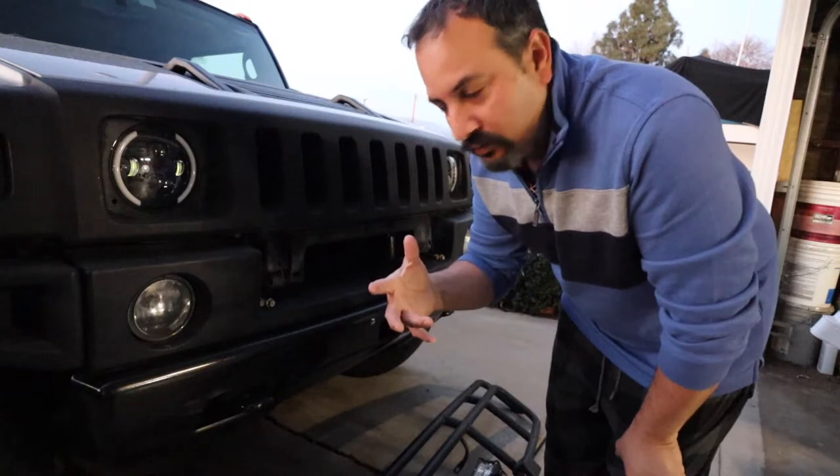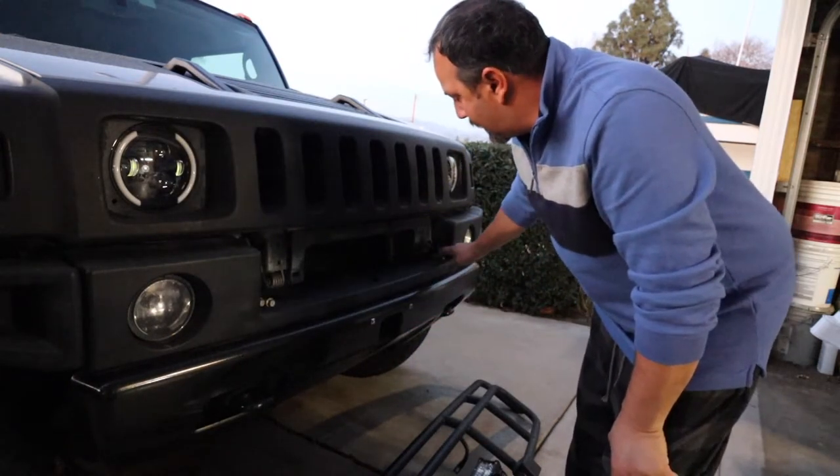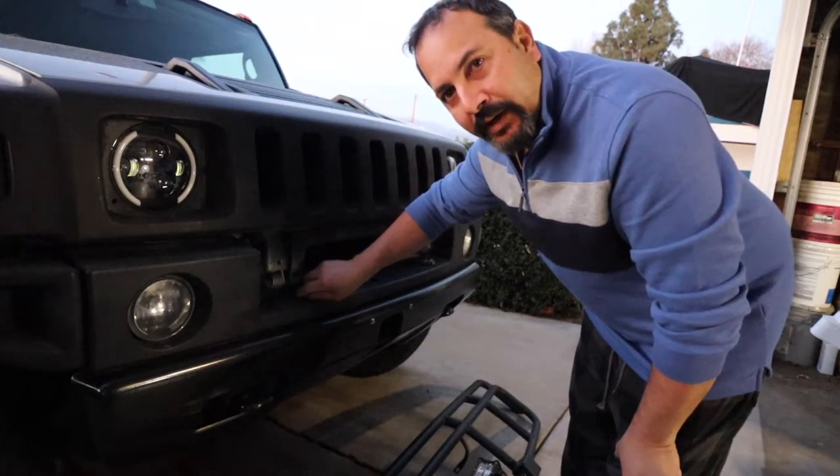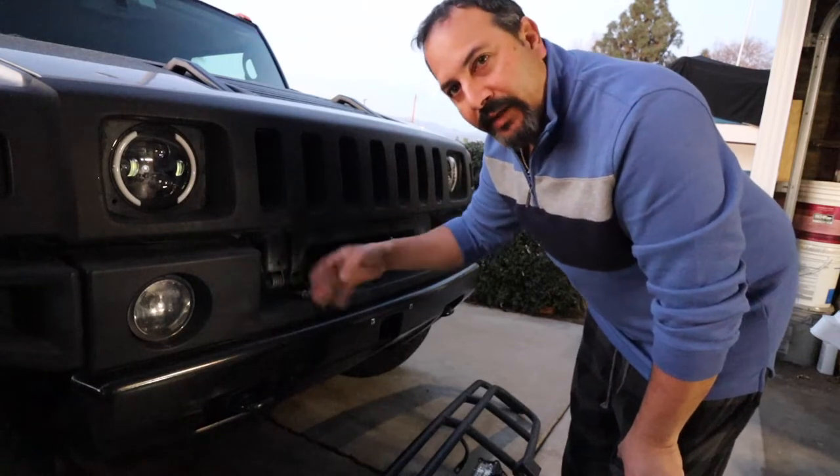The way I'm going to do it now is I'm going to take the grill with my left hand, pick it up, line up one of the sides. In my case I'm going to line up the right side, and once I get it in the right spot, all I'm going to do is put one screw in there — just screw it in at least about a quarter inch. Remember the grill is heavy, so you want to screw in enough so that if you have to let go of that side of the grill, it doesn't fall. If you don't want to have the screws in your back pocket, you can lay down two right here on this corner and two right over here — not all the way to the firewall, more towards the middle — because when you pick up the front grill you might go up and down and knock out your screws.